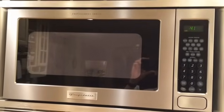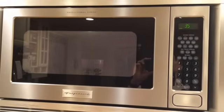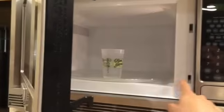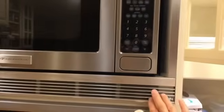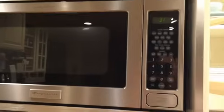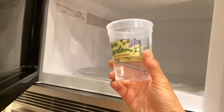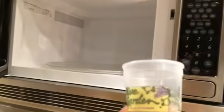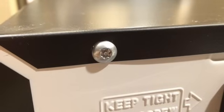I was a little confused how the light could be on while nothing's happening. After looking at the schematics, my theory is that one of the two door switches is broken. I have to take this whole thing out, remove the trim kit, and open the microwave up. There's no heating, no buzzing, so it's not the diode and it's not the magnetron.